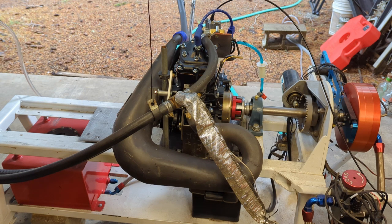Nice! Fired right up, came to a nice idle. It's fall here in Washington, so it's pretty cold out. We've got the door open so we can run on the dyno. Right now our water temp in the motor is about 60 degrees, which is too cold to start making runs. So I'll go ahead and run it for about 5 or 10 more minutes, get it warmed up real good, make a couple of quick short bursts, and then we'll start doing break-in runs.